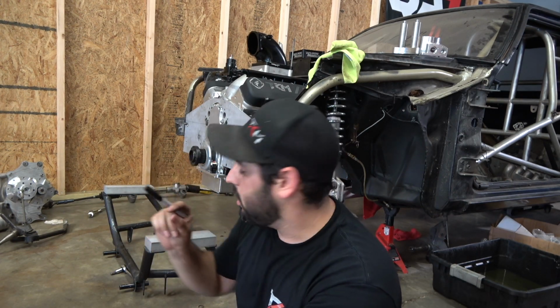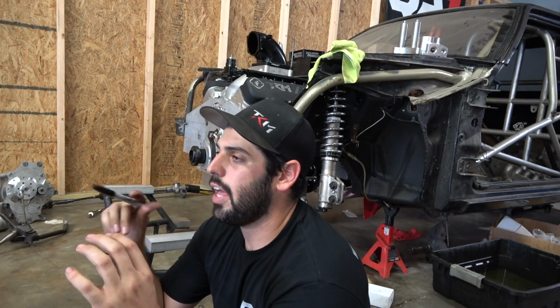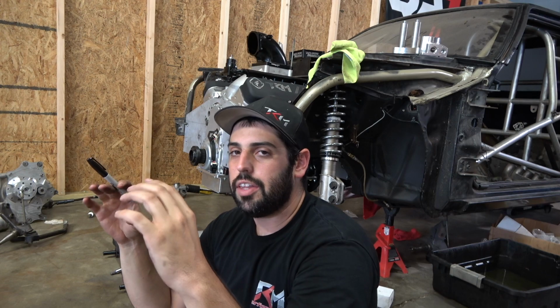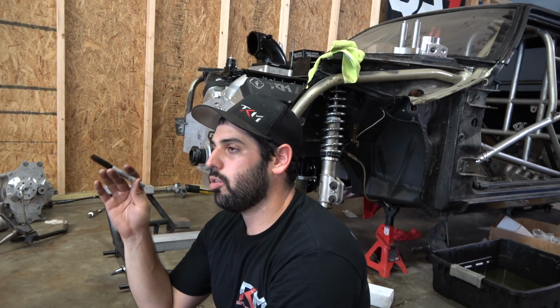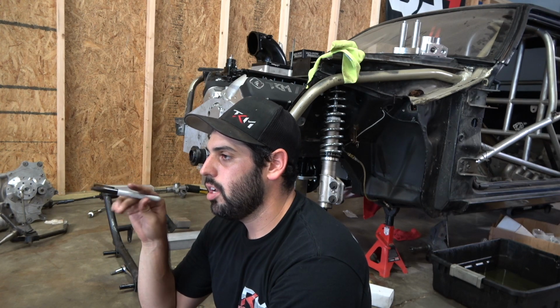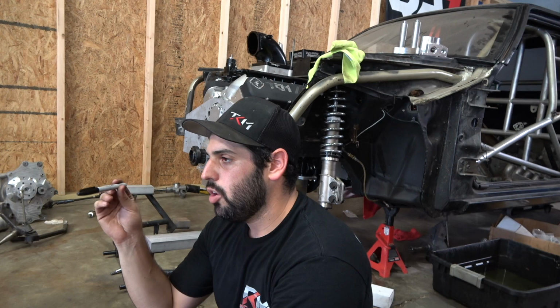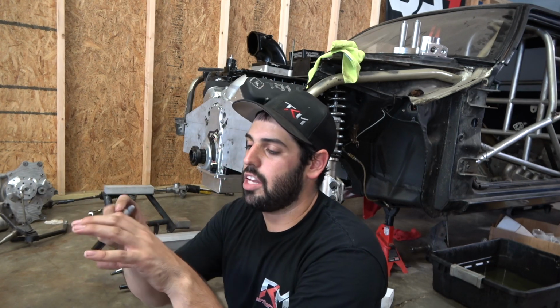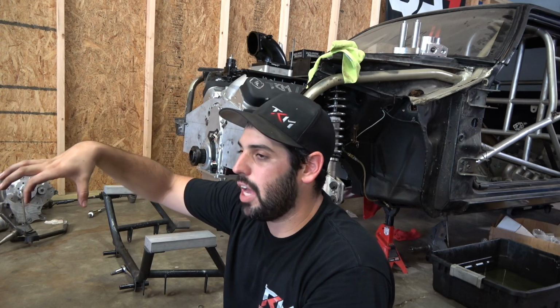It's pretty close, not a bunch of room, but like I said before, I got the steering rack that has the two bolt hole style, and then there's the standard, I guess, pinto rack that you could say. The pinto rack has, most K-members that run that have a tube that comes off of it with a half moon that it sets in, and they put a worm clamp on it, and then they have an actual clamp that clamps down the other side.